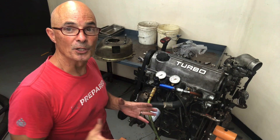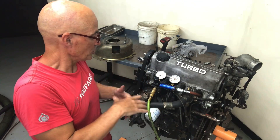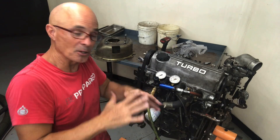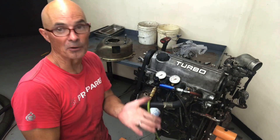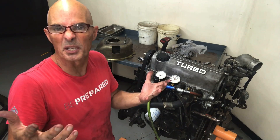One of the things that can happen when you're putting air pressure in here: if you don't have the piston right at TDC and you start supplying air pressure, it can actually push the piston down or back the other way — down in the direction it's going. You'll see the motor will move around, and you just put it back into position. Not a big deal.